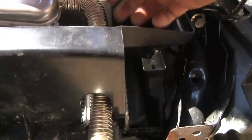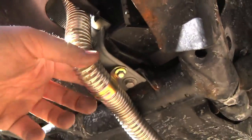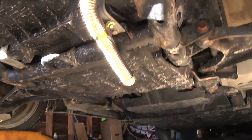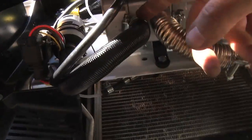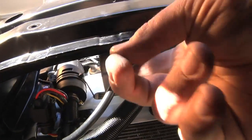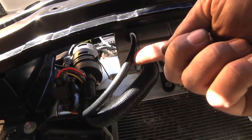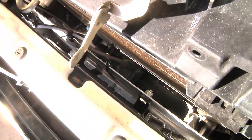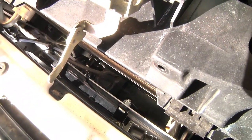Coming down from the muffler, I cut a hole in the black plastic trim and used a bracket and a self-tapping sheet metal screw to go up into metal, so the exhaust clears the plastic, clears the metal, and goes away from the vehicle. The air intake goes to a little muffler that's zip-tied up out of the way. I also made sure the wire harness for the boiler was up and out of the way. The fuel pump is on the other side of the plate, kind of hard to see down in there, but it's between that mounting plate and the radiator.